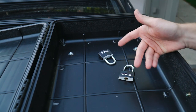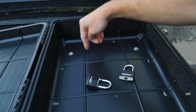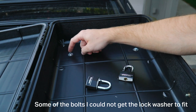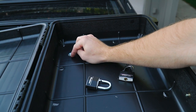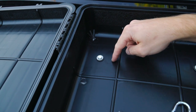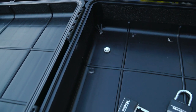When mounting these cases to your roof rack, figure out the spacing of your two crossbars, then drill holes through your case the size of whatever bolt you decide to use. Use a standard flat washer and a rubber washer — the rubber washer does a really good job of keeping that area fairly waterproof. Just make sure you're not going to hit any structural plastic lines, and there are some plastic feet to avoid too. The four-corners method works pretty well to keep it fairly locked down.